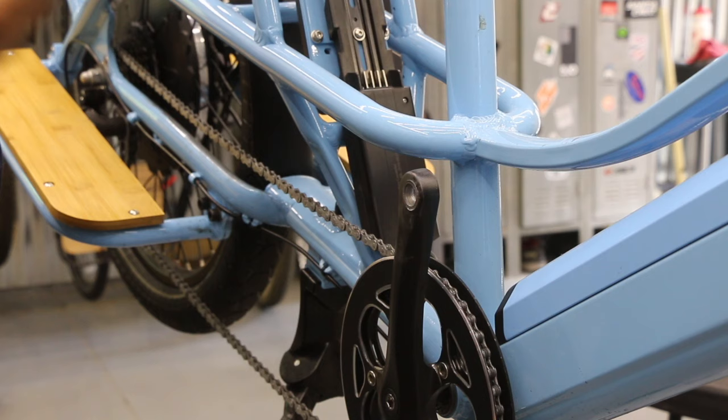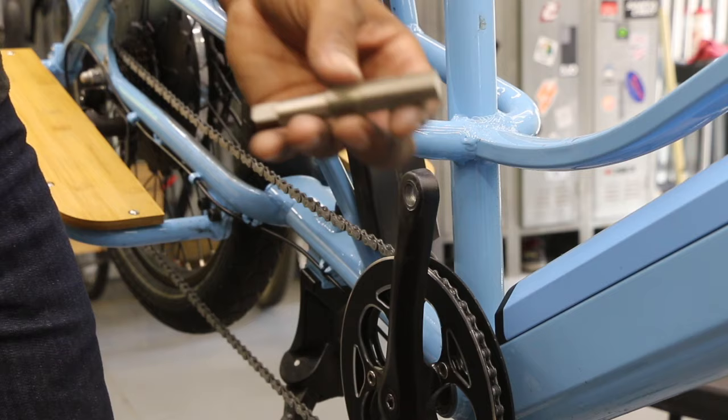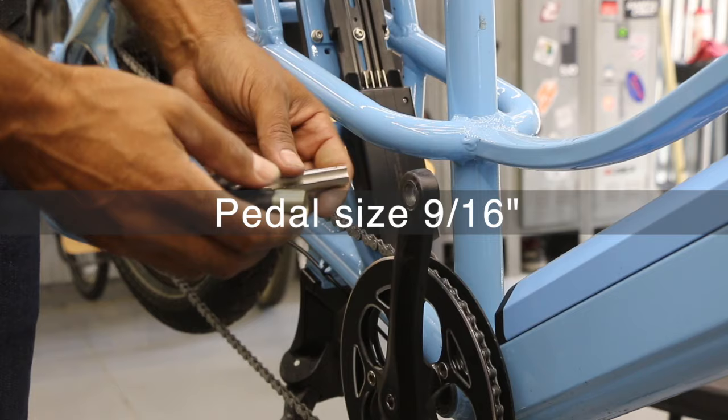We're going to clean this up — basically making this hole maybe a little bigger, getting rid of the remaining threads, and then forming some new threads. We're going to use this tool — it's a Unior, called an ART 1695 1AL, which is for the left. Make sure you're getting the correct size for your inner thread here; this thread's going to fit most common pedals of today.